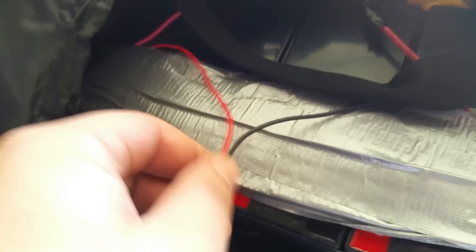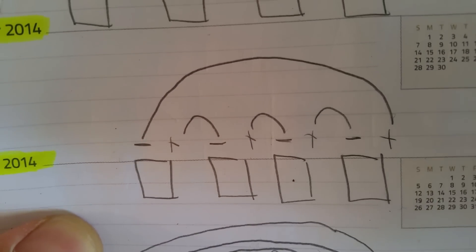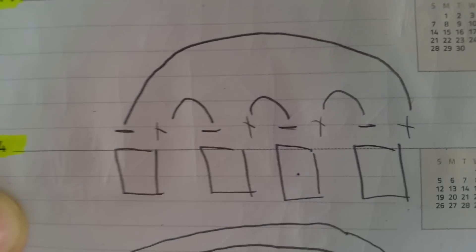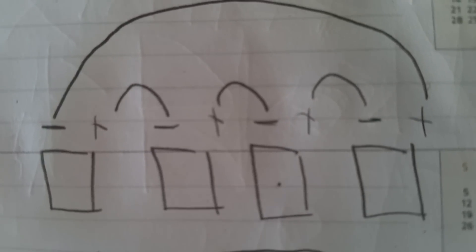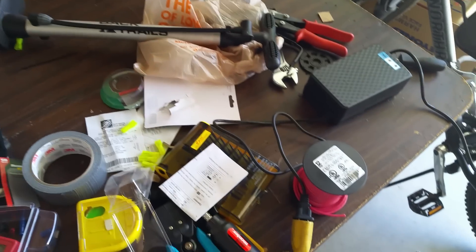Make sure it's the correct positive or negative terminals. I'll show you how I did the wire installation — it's just a simple positive to negative, positive to negative, positive to negative, and then at the end, negative to negative. The last two are the bullet connectors: one going to the positive terminal for the controller and one going to the negative. I also connected the charger port at the same time. I connected one end with the charger terminal, so this goes into the battery with the charger, and the other end connects to the controller.